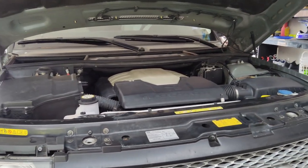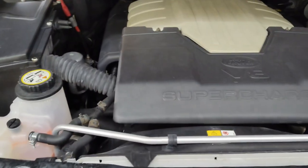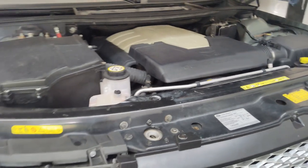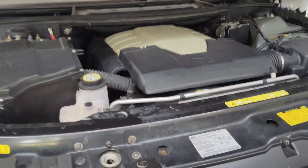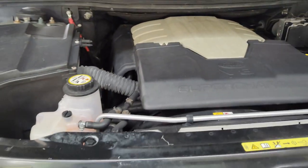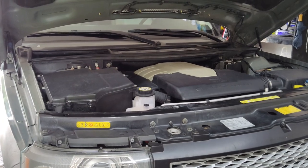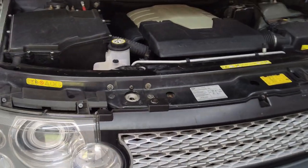With the vehicle running it should be around 14 volts or a little bit over. This vehicle developed a whine at idle — you could hear the alternator whining — and now it's completely frozen, it won't even let the vehicle turn over. It did have a little bit of an electrical smell when running. At this point it won't turn over; it could be the idler or something else, but I'm thinking it is the alternator.